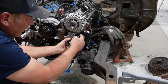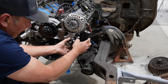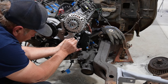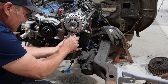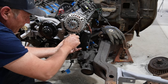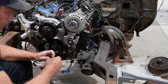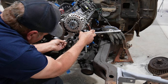So I think the generic pumps, Holley may have some additional clearance, but all I really did is I slotted this top hole, and elongated the middle hole a little bit so I'm able to get bolts and stuff through there. It was quite a bit less than 1/8 of an inch that I had to adjust, but I wanted to make sure that I had some adjustability in there. Those holes are slotted from Holley anyway, so really just making the slots a little bigger. Really not any big deal, I don't think. So we'll see if we can get this other one in here.